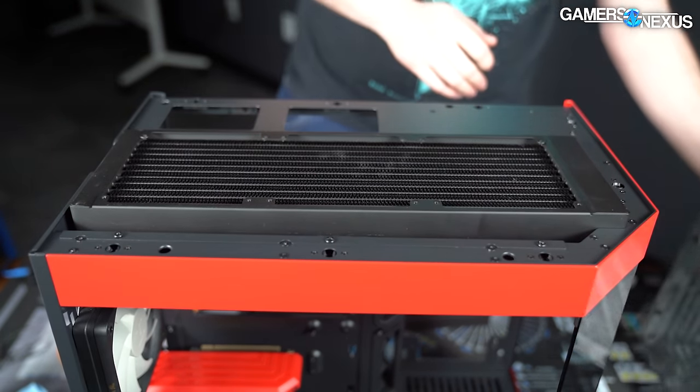Compared to the rest of the chart, 57 degrees is on the hotter side. Comparing the Y60 to the O11D, the O11 XL, and the O11 Evo may not be completely fair since we had to add our own fans to Lian Li's cases, but all three averaged better than the Y60. Moving the Y60's intake fans to the more air-cooling-friendly side mount puts it on par with the be quiet! 500DX's 49-degree average — and we actually like that case — although the stock fan-equipped O11 Air Mini still did significantly better at 44 degrees average. The Y60 can definitely be made good for cooling air- or liquid-cooled systems, but it takes more care than more standard cases.